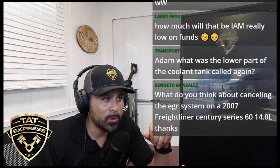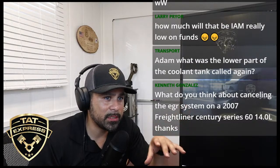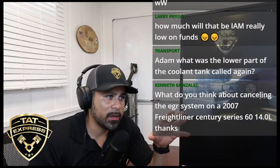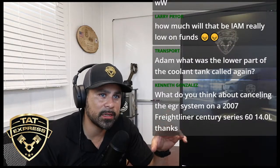Trucks are also heating at idle easily. Fan on. If the fan is on and your truck is heating up, what type of engine is it? If it's one of the newer DD15s, check your water pump. A thermal infrared thermometer is a very good tool to use when trying to track down overheating, especially if you see it getting hot while parked.